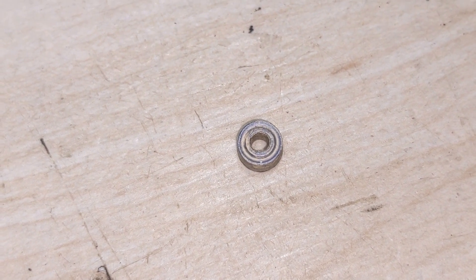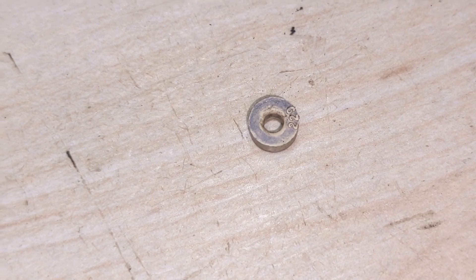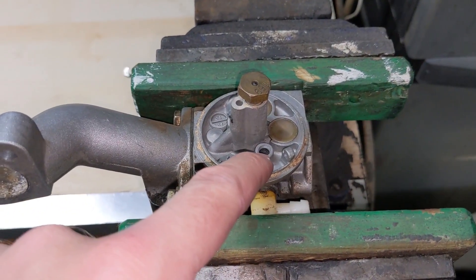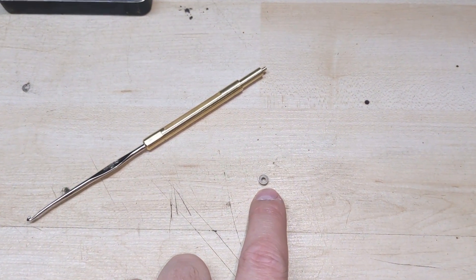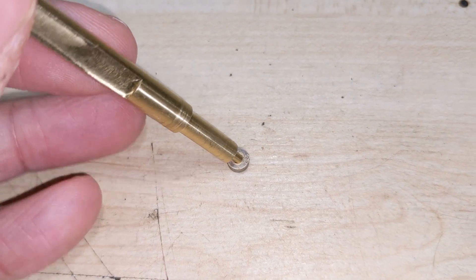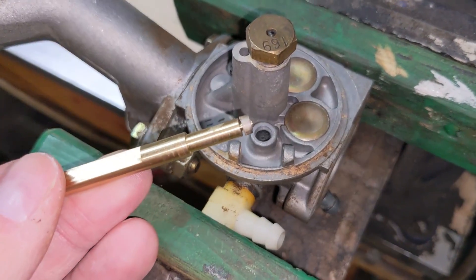Before we do that, I wanted to show you that there are going to be two sides to the seat. You'll see one side with a little ring inside of it, and if we flip this over the other side does not have that little groove in it. The groove always goes down into the carburetor — that allows the bottom of the seat to compress, almost like a compression relief ring formed into the seat. So we're going to install this with the smooth side up, press the seat onto that little nub, take it over to the carburetor, and push it in to install it.